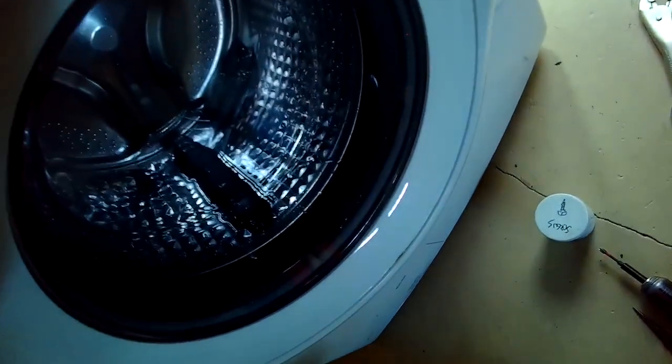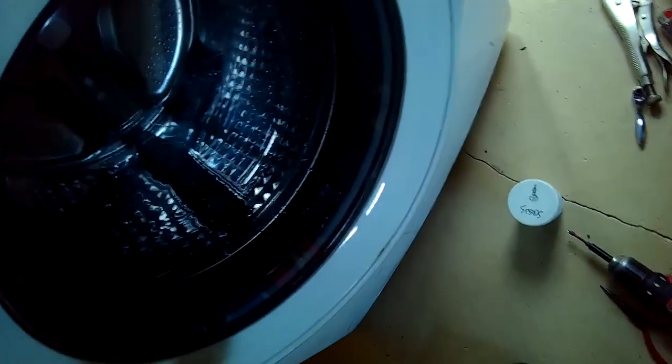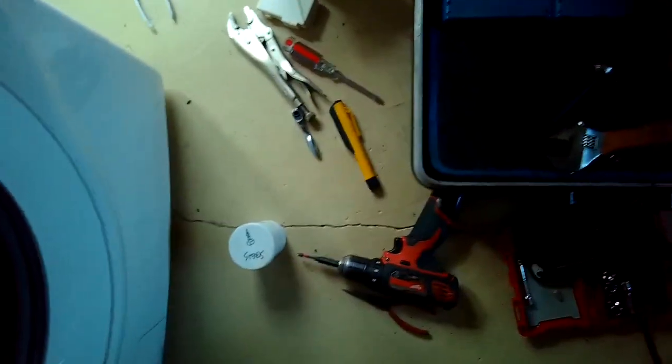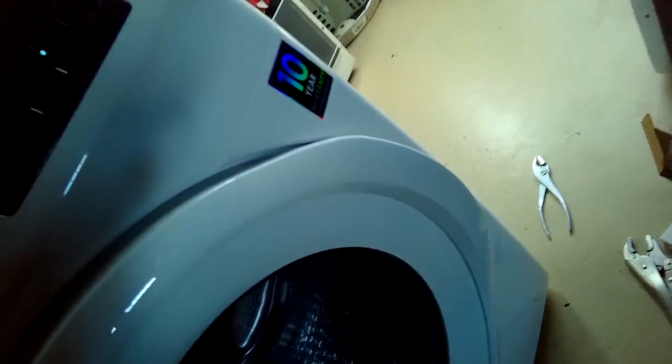When I press start, first thing happens is the drain motor kicks in and I can hear it. I know it's working. I can hear the motor and I can hear the water moving and I can see the water disappearing. You can also take out the tube a little bit while it's running and just visualize that water shooting out. So we know that that pump's working good. Probably the old pump was just worn out or the impeller had gotten broken loose.